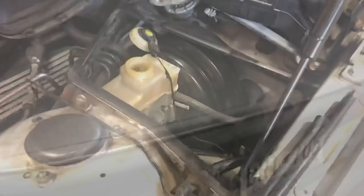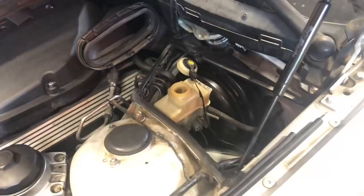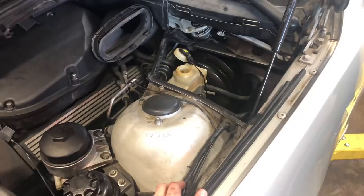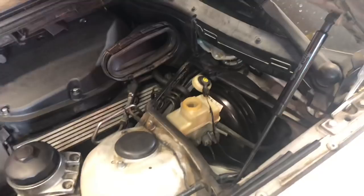This thing actually has a brand new brake master cylinder in it that my buddy Brandon put in the car before I picked it up in Texas. However, it didn't fix the brake issue. So since those lines need to be replaced anyway, I'm going to go ahead and rip the rear wheels off, get those calipers off, replace the lines, and then attempt to bleed myself alone — although I'm guessing this car will require some aggressive pedal pumping from an assistant. So I doubt the brake issue will get fixed today, but at least we'll give it a go.